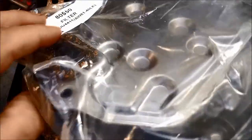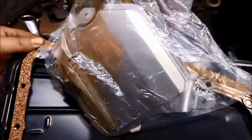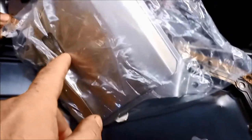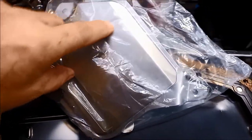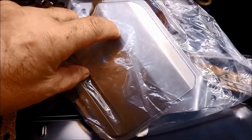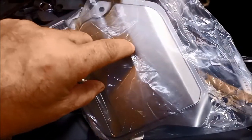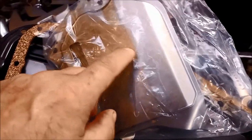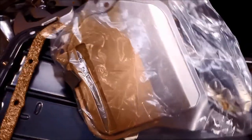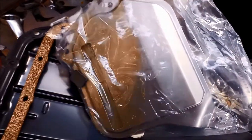For the filter, make sure you've got the gasket on there. These filters do look similar, but the way they're measured is where that little fold is - how far from the pickup. This one's 55 mil and you've got a 25 mil version - that's how you distinguish between them.